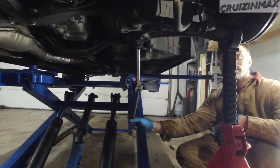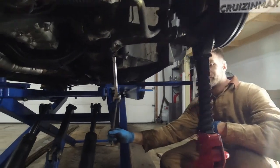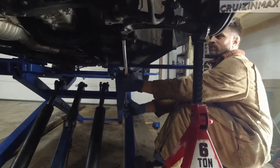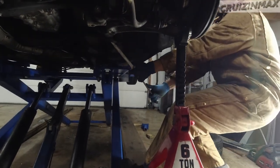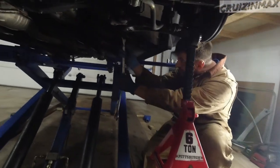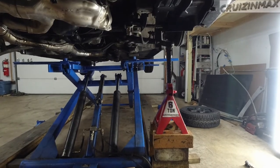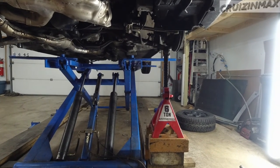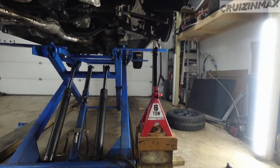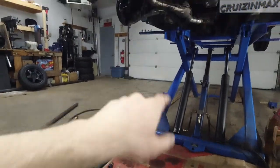Guys, always tighten up your bushings with the suspension compressed. Now Luke is going to torque it to 184 foot-pounds of torque. I'm going to help him. Click. All right. Click. I'll double check. That's probably 250 by now. Nice. No squeaks so far. Alright, that's enough. Now we're going to move this to this side and repeat the process.